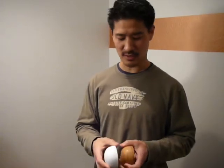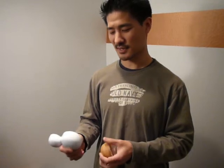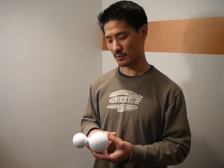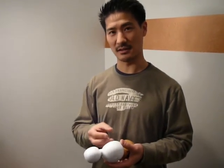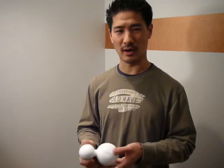Another cool aspect of the tweeter pod, relatively cool aspect, is that you don't see the wires, because the mounting bolt is a custom threaded 1/2 inch rod with a washer. So I created my own bolt with a 1/4 inch passage, so even after you tighten the bolt in place, the wires can run through the bolt, and makes it so you can have no wires.